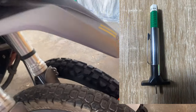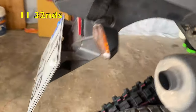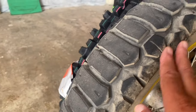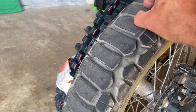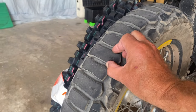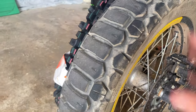They've done just under 5,000 kilometres — about 4,900 kilometres — and the front, as I measured it, it's still got 8 millimetres on it. When I look at the back it's about 11 millimetres, and again a nice rounded profile. I've talked about these in my review and they've lasted all this time and they've still got all this tread. It's not a massive big powerful torquey adventure bike, but these are good tires.